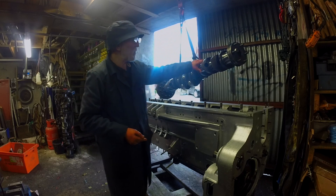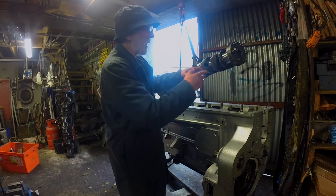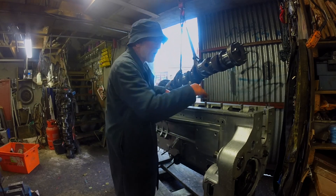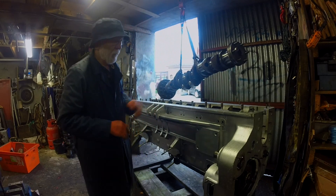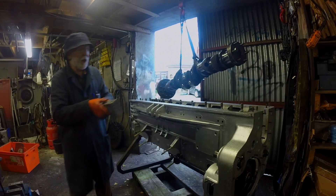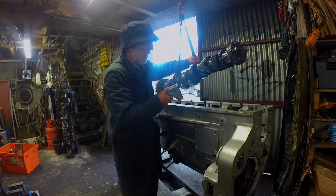The surface of the crankshaft — these surfaces are, of course, highly polished and very precisely machined to take the main shells. We place the shells down in the crankcase, lower the crankshaft down on top of those shells, and we will then fit these bridging pieces, which have to be precisely torqued down so that they engage on the other surfaces of the bearing.